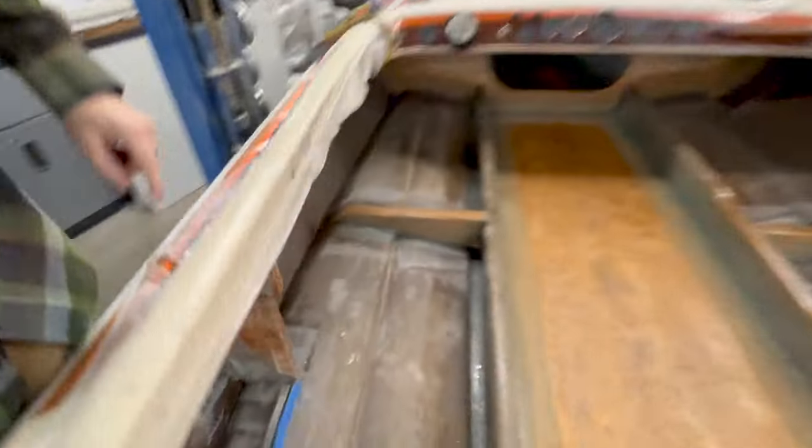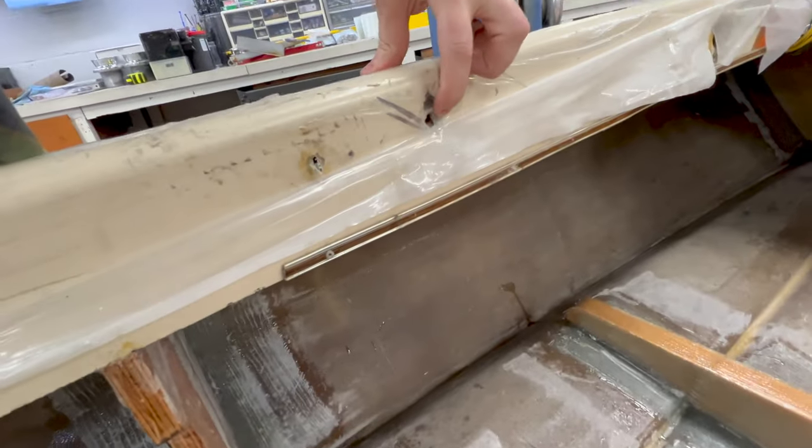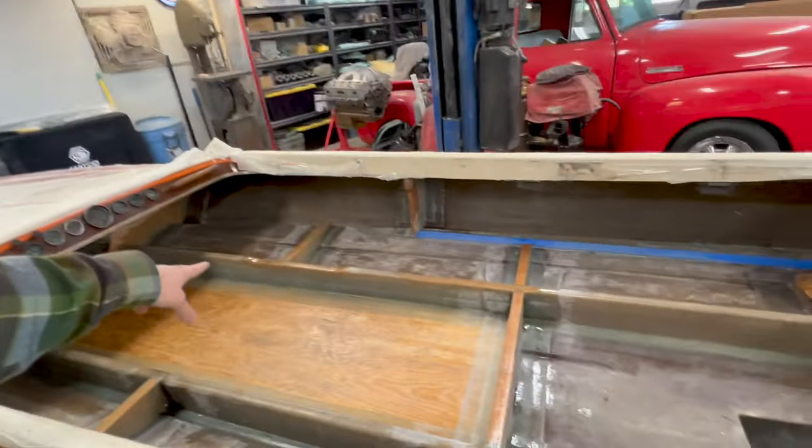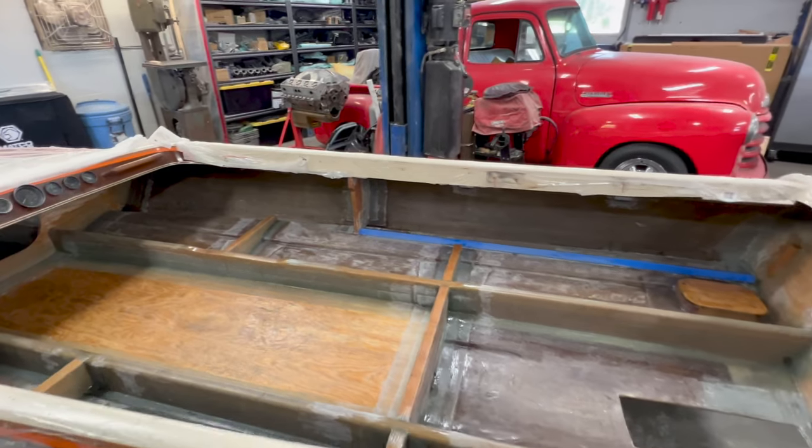Now, some of you are probably wondering why I didn't just raise both seats, and that's because both seats actually have a bolt that is bolted through the side of the wood of the seat from the inside to the outside, and those bolt in up here on the side of the gunwale. Well, since that interior is so new in the upholstery, I can't get that bolt changed, so that dictates the height of the seat, and I didn't want to drill new holes in the boat, so I went with the option of just lowering it back down, retaining my bolt holes.